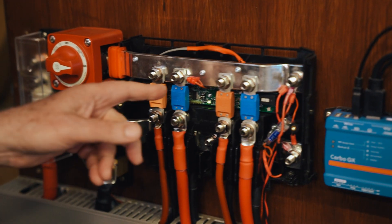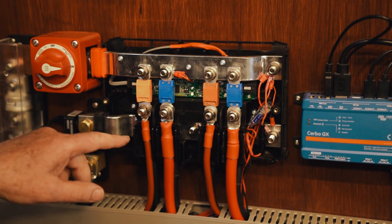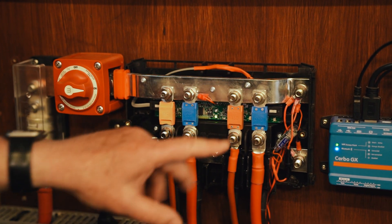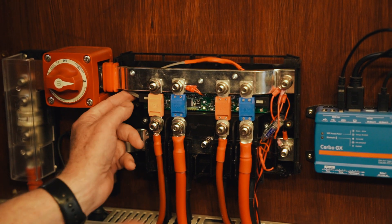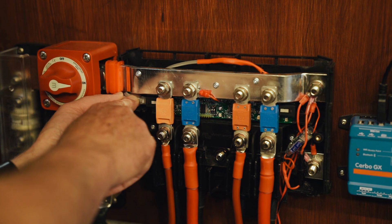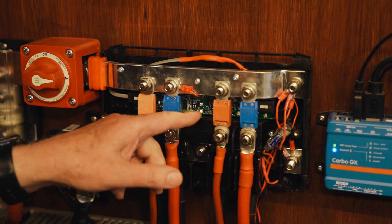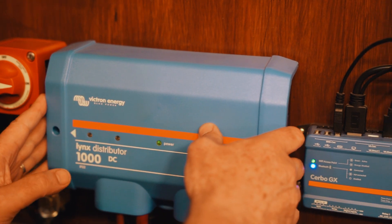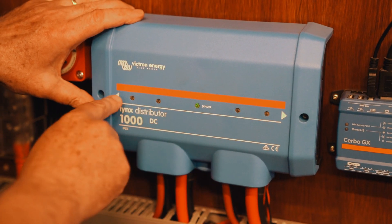There we are — we have some LEDs and it's gone completely green. Just to show you: if I was to take one of these fuses out or if it was to blow, then straight away this will go red or amber and it'll show that this fuse is actually blown. You can see each fuse has its own LED. In case you missed that, let me just take it back out again and push it back in so you'll see. There's no power — I'm going to push it back in and see the various fuses light up. But at the moment we're nice and green. If those were to blow, you'd see quite clearly which one has actually blown.